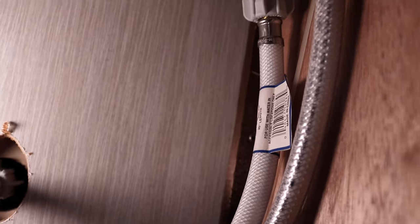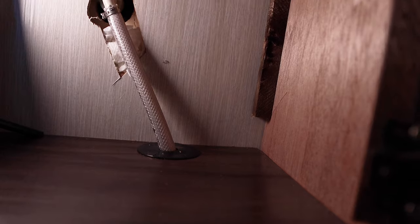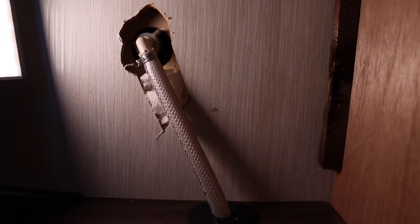What I came up with was a different method of connecting the hoses. As you can see, there's a hose going in, into the vacuum breaker, and then from the vacuum breaker down the hose to the black tank. I wanted to get rid of this vacuum breaker being inside the RV, so I needed to take it out of the system and hook the hose up to the outside connector directly — that way no water leaks on the inside. After some mild modifications to the wall and disconnecting some hoses, I found that the hose coming off the vacuum breaker going to the black tank would connect directly to the outside connector.